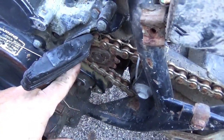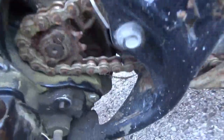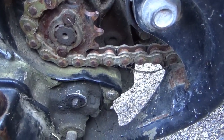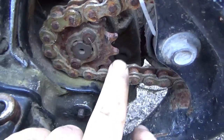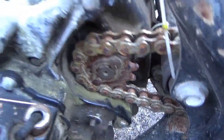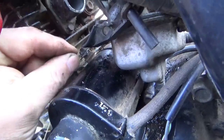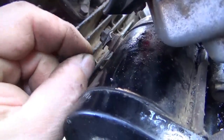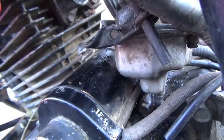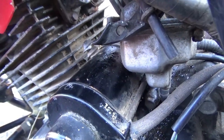This is the first time I've seen it. This one actually has the case guard in it — I've never seen that before. Just in case somebody wants to build one, it's just a plastic insert that keeps the chain from blowing through the case should you throw it. The wire that would go on here is broken off, so I don't know if the starter's any good. The plug's out — now it's time to turn the motor over and we'll see how much trouble we've got.